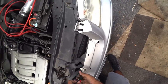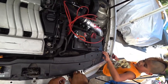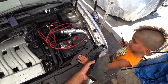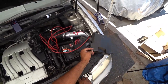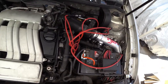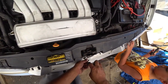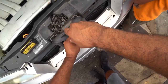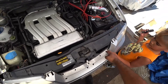So right on the front of the car there's one, two, three, four, five big bolts here. And that gives us more access. So we're here getting ready for the bumper removal. Remember, once you take the grill off, five bolts here. Don't worry about the headlights yet.